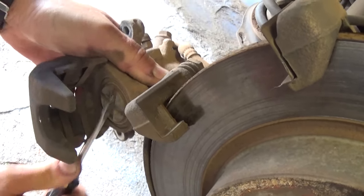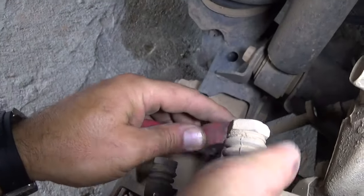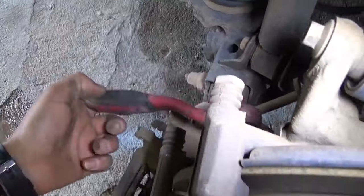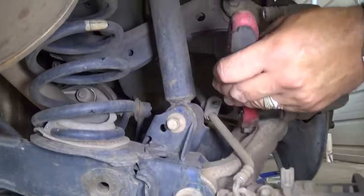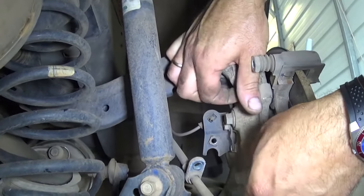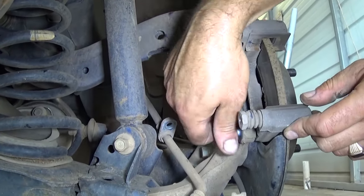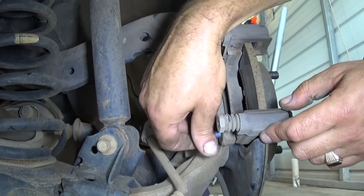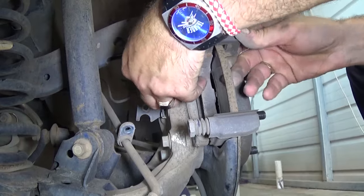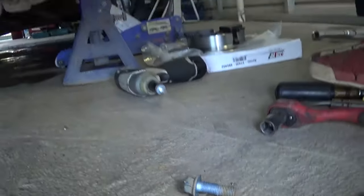You can do it by hand at the shop or even on the side of the road — that's how simple it is. On the back there are two bolts with a 14mm socket that we need to remove — they hold the mount for the brake caliper. By removing those, we'll be able to remove the brake rotor, because otherwise it holds the disc and you won't be able to pull it out.